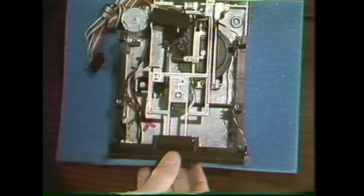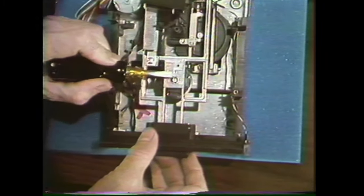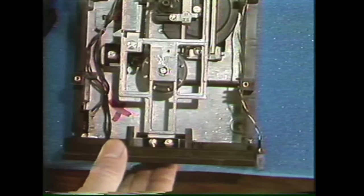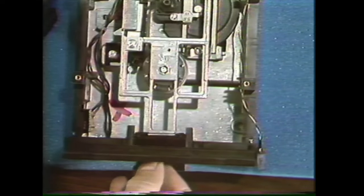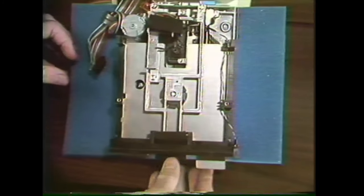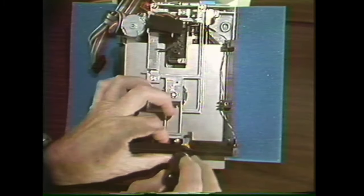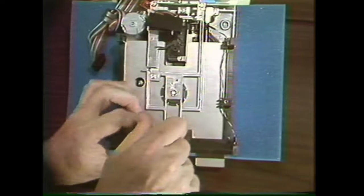As a further check, open the door, push the hub off center, and it should go right back to the middle when you reseat it. When it's properly adjusted, all you have to do is slip the adjustment tool in the way you learned in module DD1 and adjust the front door and tighten down the screws.